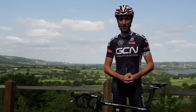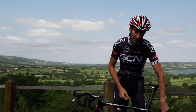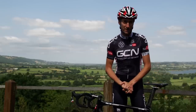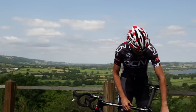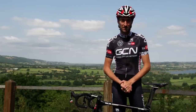Another common reason for poorly performing brakes when you're out on the road is the actual pads not contacting the rim surface correctly. If the rim pad is too high, it will be touching the tyre, it will eventually wear through it, and you'll have a puncture out training which you might not even be able to fix. Too low, on the other hand, and you'll start to gouge or scratch or even create a groove below the rim braking surface, which is the last thing you want, especially if you've got some expensive tyres.